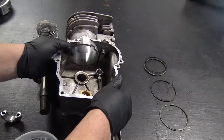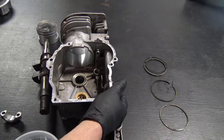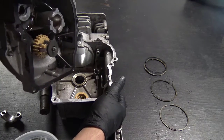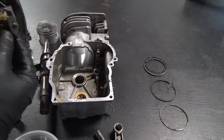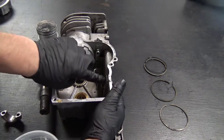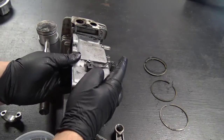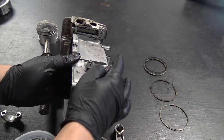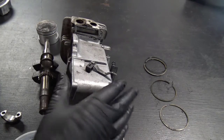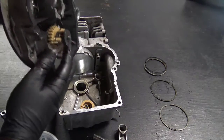The engine's all taken apart. I have two items left in here: the crankcase breather, and this right here is the governor arm - you can see where it goes through the outside of the case and where it goes on the inside. When you put the engine together, this arm sits more upright. The governor works by the flyweight plunger pushing down on this governor crank as it moves out, which moves the governor lever clockwise - and that would in turn close the throttle. When you do the static adjustment, what you're doing is getting this governor crank right up against this surface.